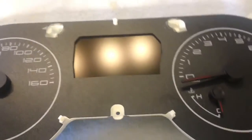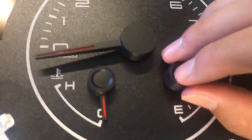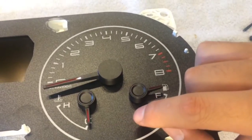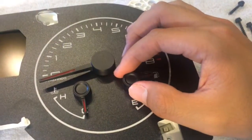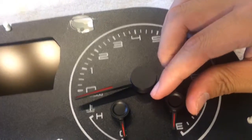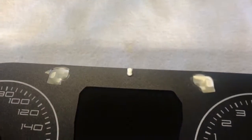Once you've got your new sheet on and put your new needles on, it doesn't matter where the needles initially sit. Just slide it on anywhere and gently push it on and it'll click on. You'll notice you have to turn it back to where the positive stop originally was — as noted in your picture. For the fuel gauge, go a little past empty since a car likes to read full at a certain position. Same with all the other needles — don't put it exactly at zero, since this cluster tends to start below zero and then settle at zero when you start the car.